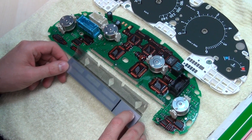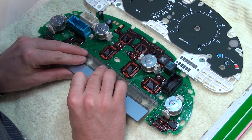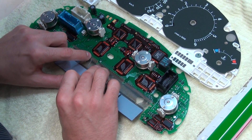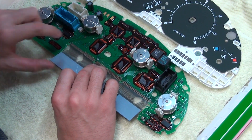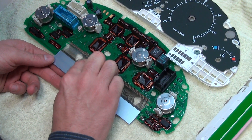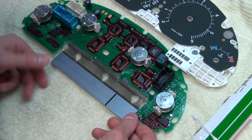I just use normal pressure. First I put the LCD — more precisely I put the cable to the panel — and I want to make sure that the pads properly match. I apply pressure and make sure that the pads of the cable match the pads of the panel. Now I go to the other side.